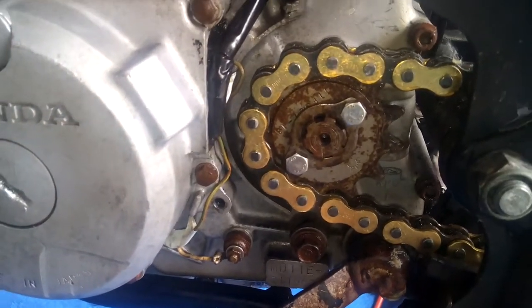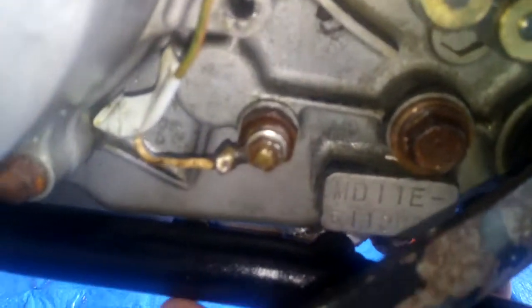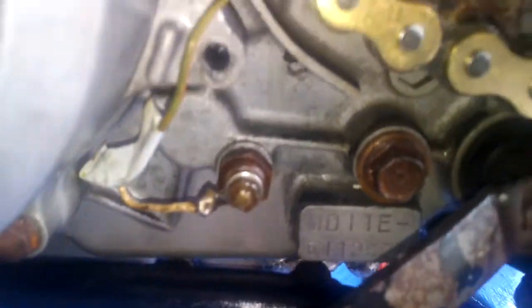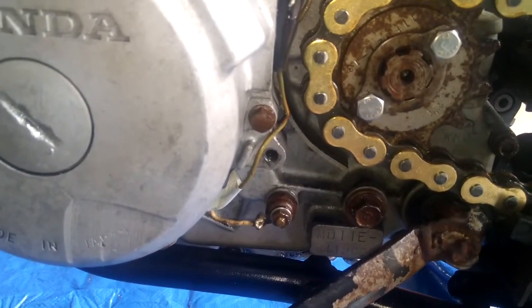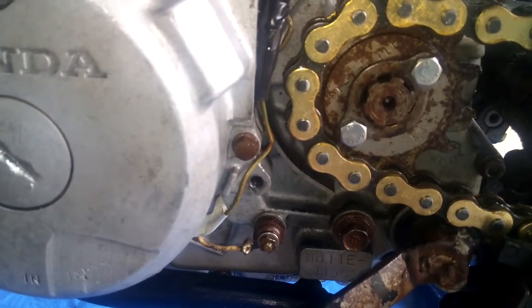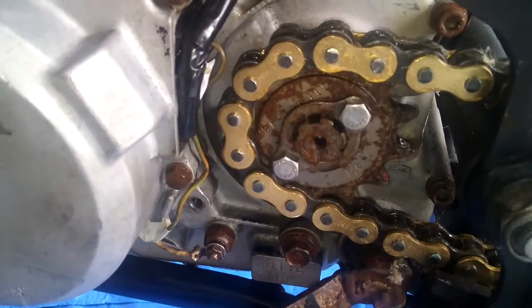I decided to approach this in a lateral way. I got my trusty drill out and made a big gouging, gaping hole up into the bottom of the crankcase — around about where my finger is here — to gain access into the bottom of the crankcase, where I put my finger up and slid the spring back. It's a coiled spring around a spindle, and the two ends of the spring extend out onto a tab on the back of the shift selector plate. Those of you familiar with this engine will know that part very well.